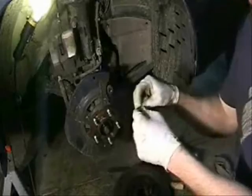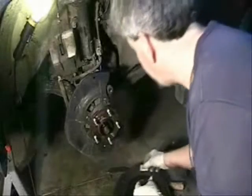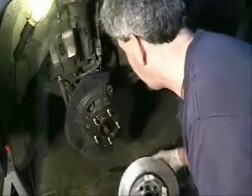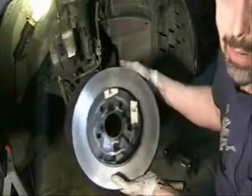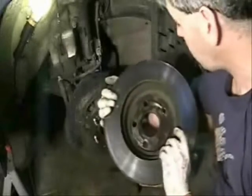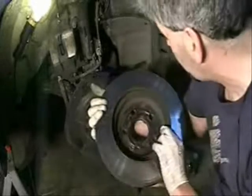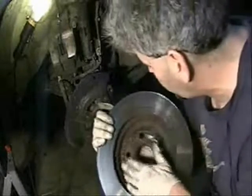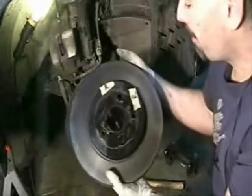At this point I'm going to get some tape. Since this is the right side of the vehicle — the passenger side is always the right side — I'm going to put some tape on here to label it. Most rotors on most models are directional, so there is a left and right rotor. I want to make sure I tape them so that when we resurface them at the machine shop we don't mix them up. Sometimes there are even markings on the inside that tell you right or left and also give you the minimum thickness — though on most cases it's so rusted out you can't tell. So definitely label up the rotor so you know.